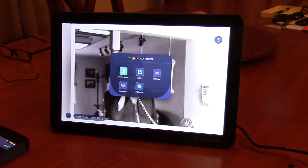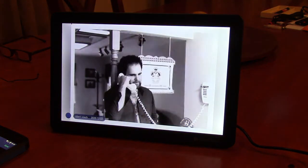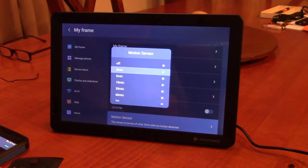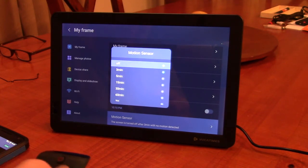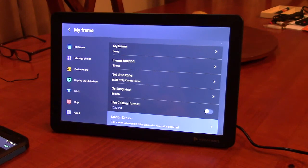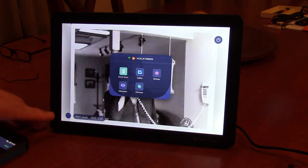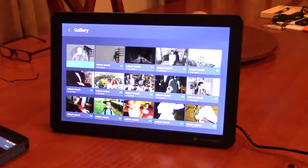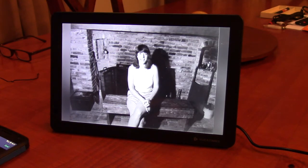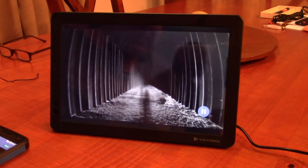Let's try the motion sensor setting. In settings you'll see 'motion sensor' — I'm using the remote, which points to the left side of the screen. Motion sensor can be off, 3 minutes, 5 minutes, or 15 minutes. That means it will stay on the screen for 3 minutes after it detects motion. The little motion sensor is right below the sensor for the remote. So you can have the frame playing pictures, then it will shut itself down, and if you walk by, the sensor gets triggered and it will stay on for 3 minutes going through videos or pictures — that's a nice feature.